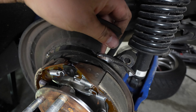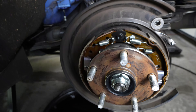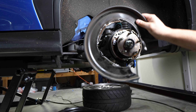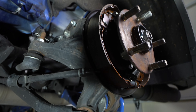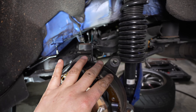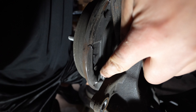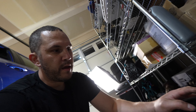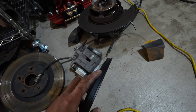This kind of has to break off at the end and then from there it'll just pull away. The one thing you want to be careful of is the e-brake line - make sure you're not damaging that when you're hitting down here. Everything is nice and free and we can slip the rotor on. Looking behind here, these are basically all the little contact points where the little spot welds are. You could spend the time to drill those out, but there are just a bunch of little contact points all the way around. You can also take a grinder or cutting wheel and cut along the whole edge - to me I'd rather just pound it off and have full exposed air to the back for better cooling.